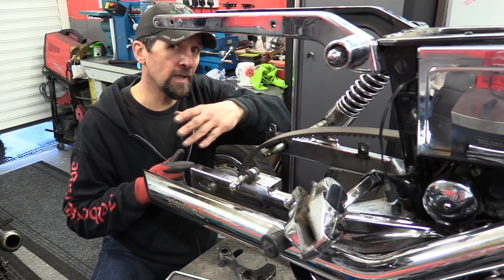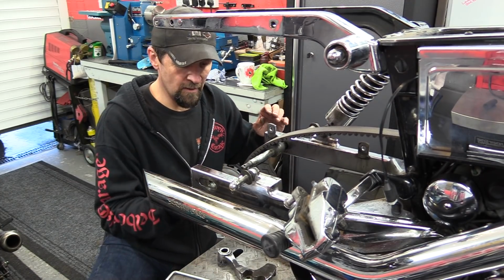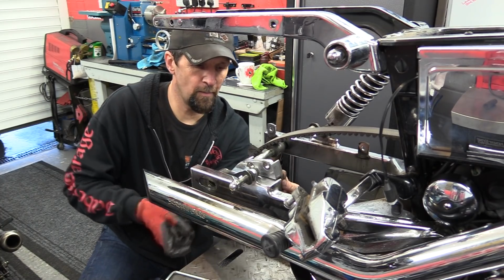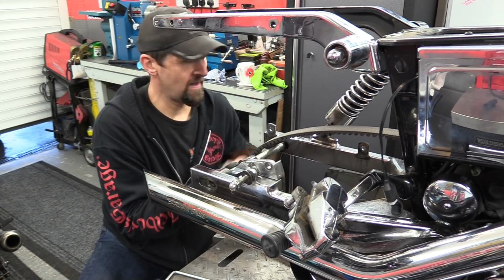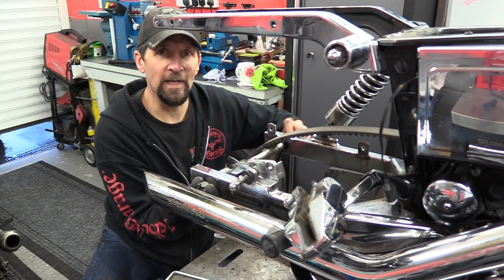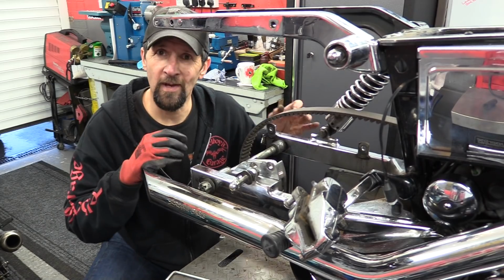Just dress it back up, reassemble that shaft. So it's axle in, then it was the big spacer. You'll clean them all up and deal with everything else later on. Then it was a washer. The bracket that holds the caliper slides onto a block, but that has a washer on the inside of it. Then that goes through, and the main washer and the main nut. Now that's assembled in exactly the same way it just came apart, in the right order. So when you come to put it back together yourself, you won't forget, will you?